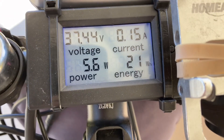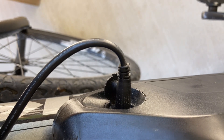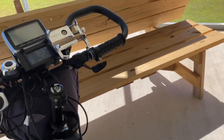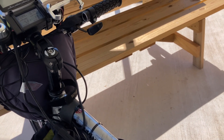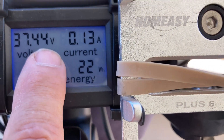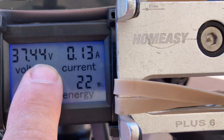The power goes from the watt meter down and into my battery. You can direct charge that battery — this particular one you can charge while you're riding. If you have a good output from the sun and you aren't using too much power, you will see this voltage rise as you're going. It'll rise in hundredths of a volt, but it'll still be rising if you are putting more in than you're taking out.